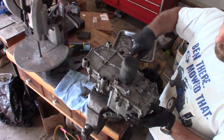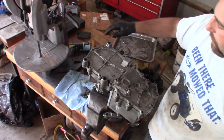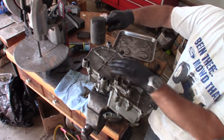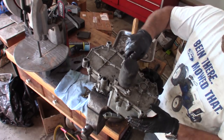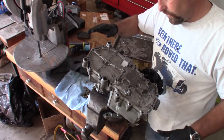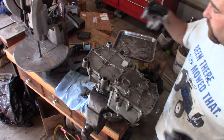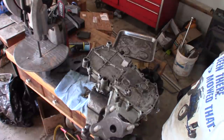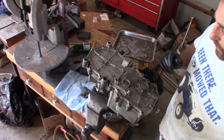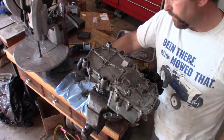Now, before you put any of the bolts in, you should check that. There shouldn't be a hollow sound. It's a little hollow there, but the rest of it's solid and everything is seated. If it doesn't seat, you gotta put the hub on and turn that shaft down there to get it all to seat. It will seat properly. You might need to turn that hub.